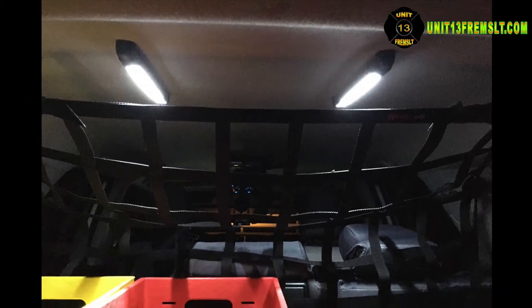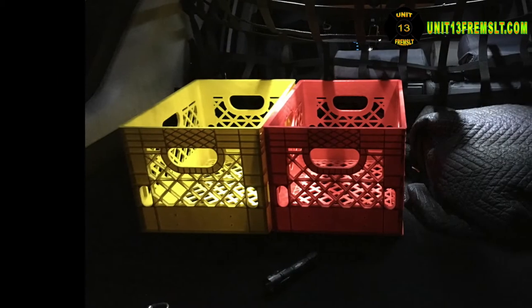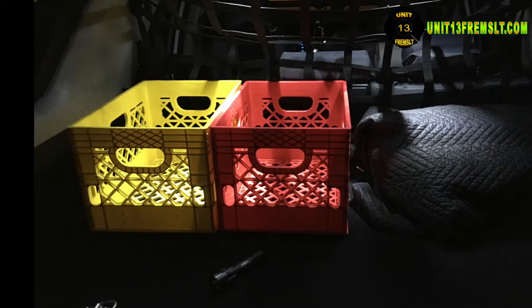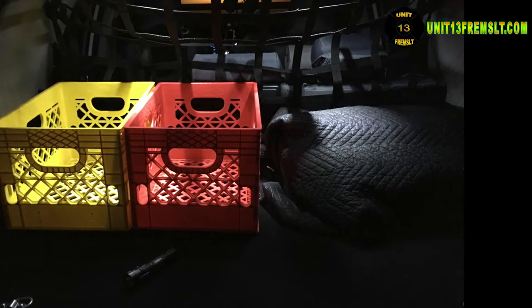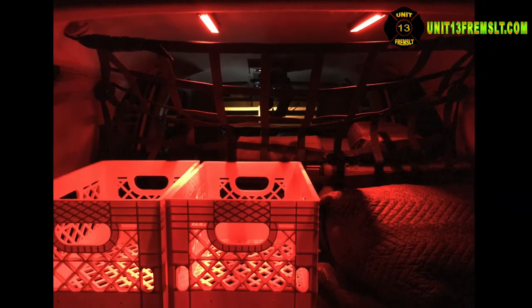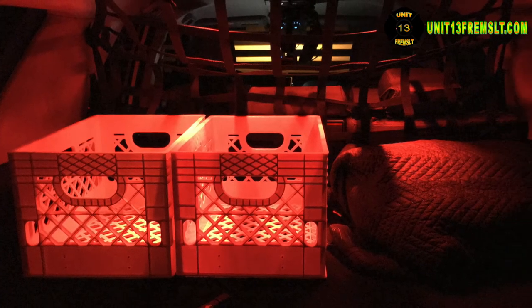I had to remove several of the rear and side panels in order to drop that ceiling down in the back, so it's not an easy task — it takes quite a bit of effort. These lights were chosen for their length and ability to switch between white and red color modes. The red is good for preserving night vision while working in the cargo area when all the other dome lights have been turned off.